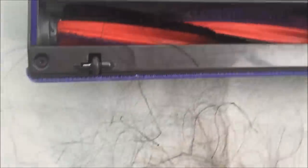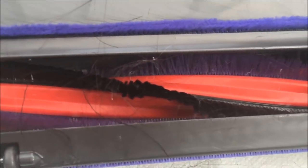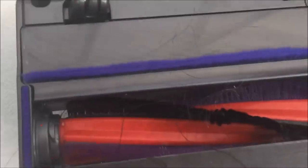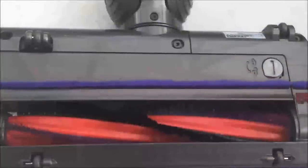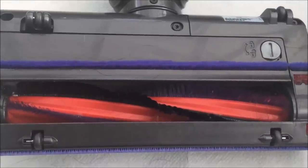Okay, so I've snipped that up. You can see quite a lot of hairs have come off. Just continue snipping through any spare hairs — obviously don't touch the brushes or the filaments. When you reconnect it to the Dyson, hit that max button and run it for about 30 seconds and you'll find that pulls everything through. The next thing you can do is take the head apart and give it a good clean out every so often.